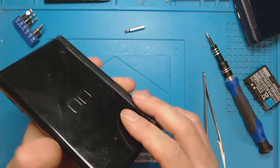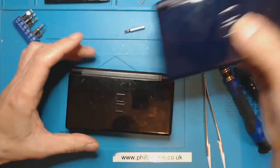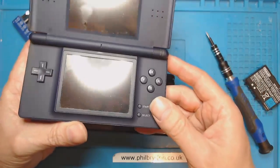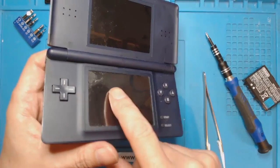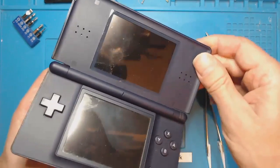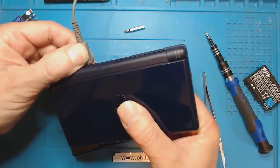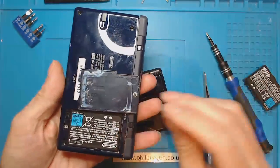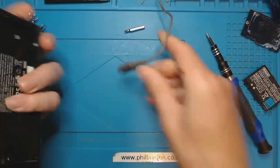I've been given some DS lights and the two I've got here don't turn on, so I thought I'd open them up on screen. The blue one - this must be a damaged screen here and here, so I think that's just two damaged screens on that one. It doesn't do anything; if I plug the charger in, the orange light comes on and then goes off. The battery compartment has definitely had some battery leakage.